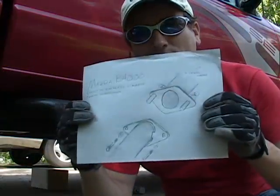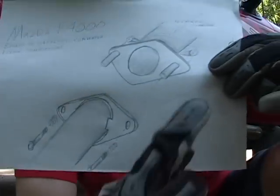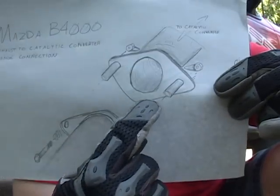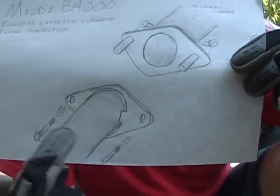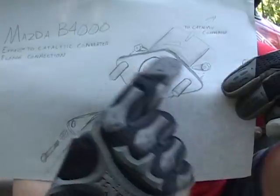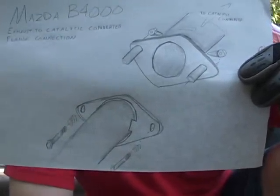So I drew my own. Here's what I think is happening here. This will be back to your catalytic converter, and I think it's got these two shafts that are welded to this flange. They're going to go through these two holes, and there's a spring and a bolt for each one. They go through and connect on these nuts, and there's a little flange off these nuts that keep the nuts from turning in case it happened to come loose. At this point, it's not going to.